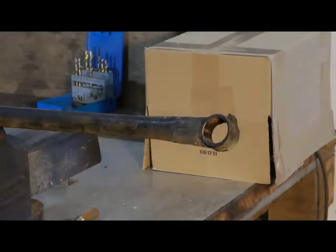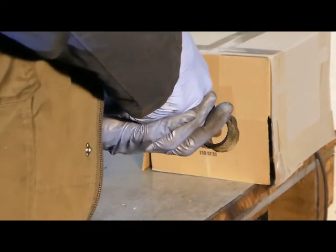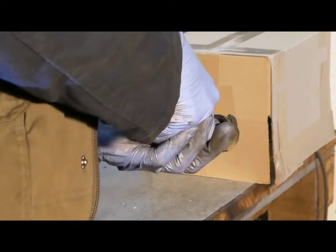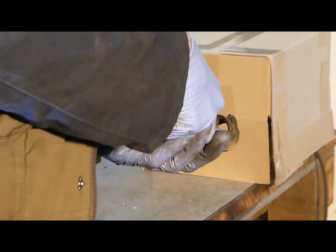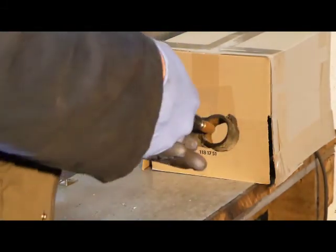We've already popped the bushes out of this Amazon Panhard rod using a small pry bar. Now it's essential to remove the rust scale from the inside of the bush bosses using a die grinder. Use your fingertips to check whether you've actually got all the scale out.